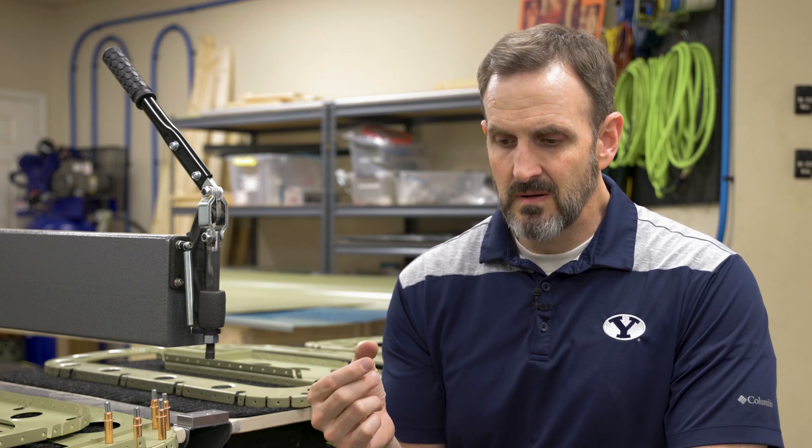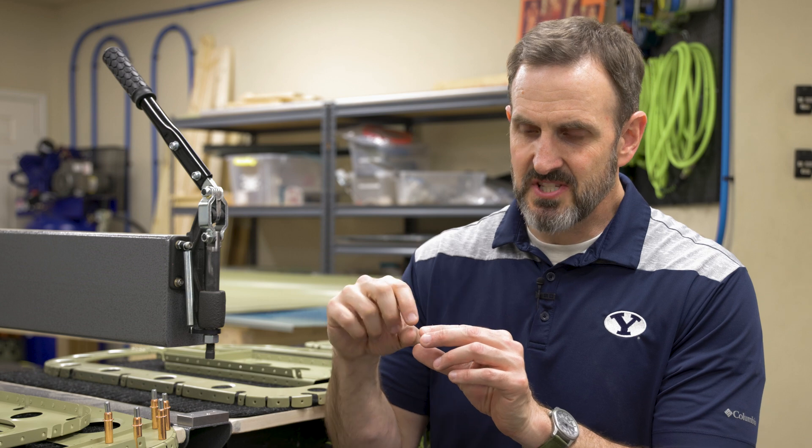I thought I put a very thin layer but I don't think it was thin enough - at least in some areas it's a little bumpy. So if you're ever going to do this, put a really really thin layer of tank sealant and that's all you really need. Then finally, on the tip ribs you have these rivets close to the trailing edge, and there's just no way you can buck them with a bucking bar. I tried it a number of different ways on the practice project - every single time I absolutely screwed it up and it looked terrible. People on Van's Air Force say they figured out a way to do it with a chisel and a little lever, but that absolutely doesn't work.